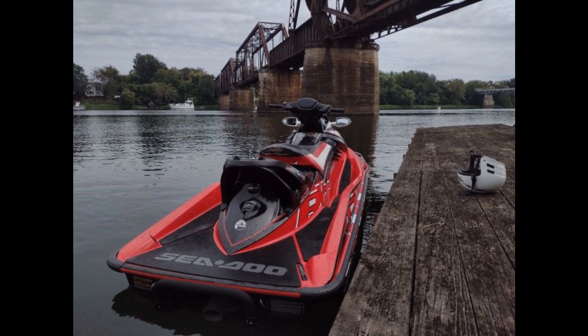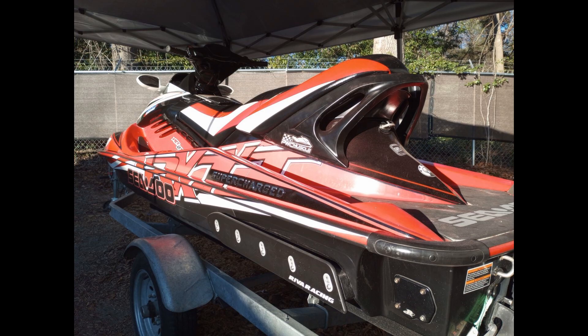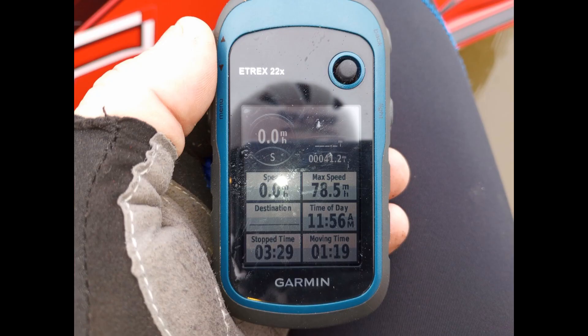That would be great to pull that out of a 2007 jet ski, being that it's so old, but it's so simple too. I've got no reverse bucket on it, I've got the back Venturi nozzle open air, I took all the fins off the back, all the assisted steering and all that — I took all that off. Everything's got block-offs. It's got the Riva sponsons, the racing sponsons, and I shortened the intake. I put a power filter kit on it. The ski ran a strong 78.5 miles per hour — I'm including a picture of my Garmin GPS. It hit 78.5 miles per hour, the fastest I ever went, with calm water, no wind, about half a tank of fuel and myself, taking the cargo compartment out of the ski so the front was very light.